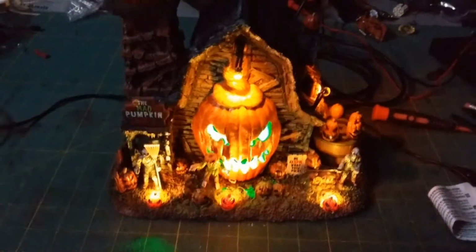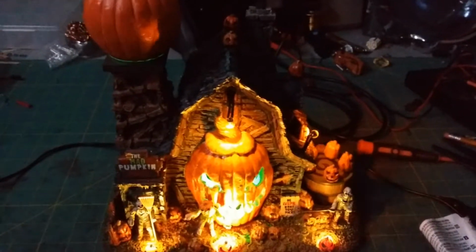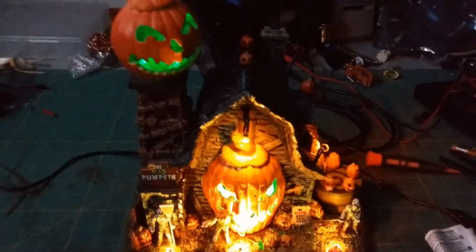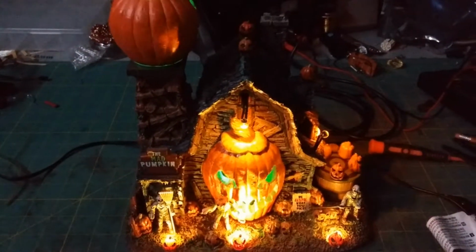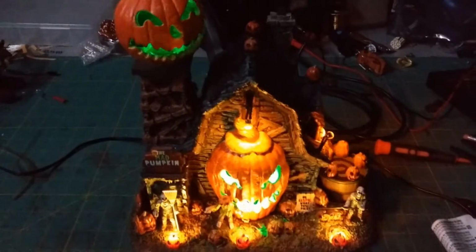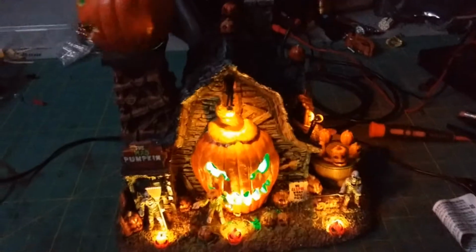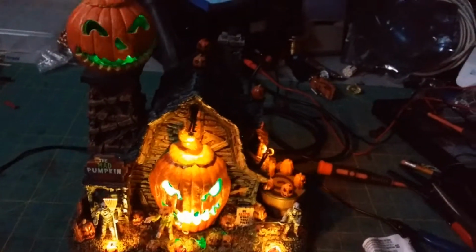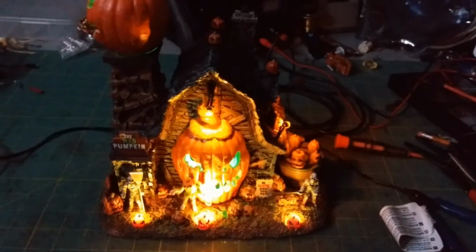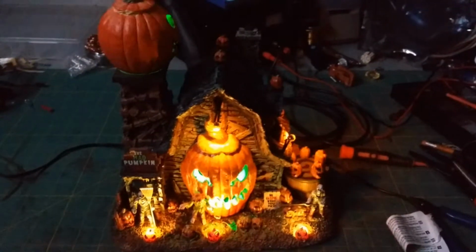The repair, for this one at least, was just crimping on a butt connector after removing all the insulation. If yours has a broken drive shaft, do the same thing. It may work for you. You can buy them with the insulation or without. The size I used is the color blue, which I, off the top of my head, cannot remember the gauge at the moment, but the gauges are written on the package. Hopefully you can do this at home, and this video will help you fix a broken flexible drive shaft on the Mad Pumpkin Patch.